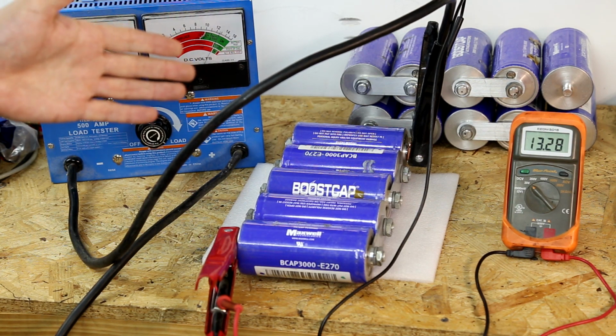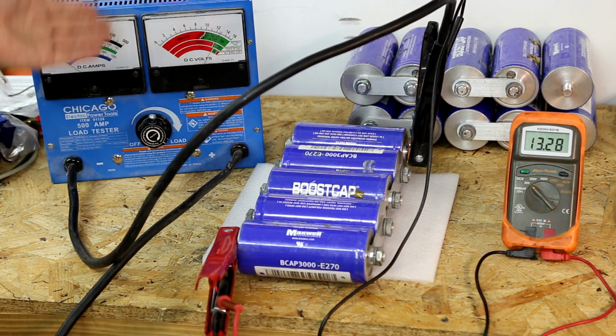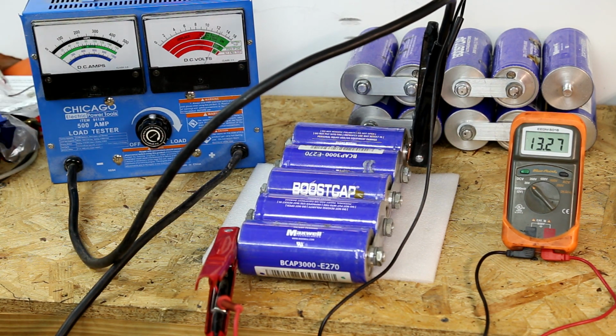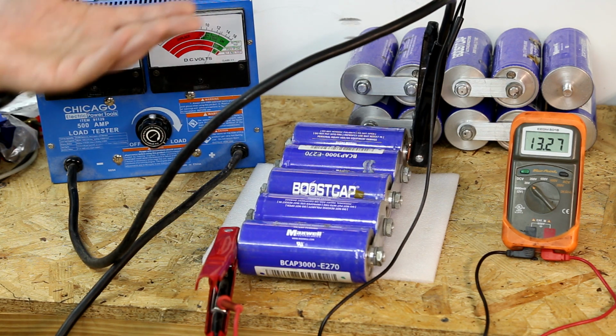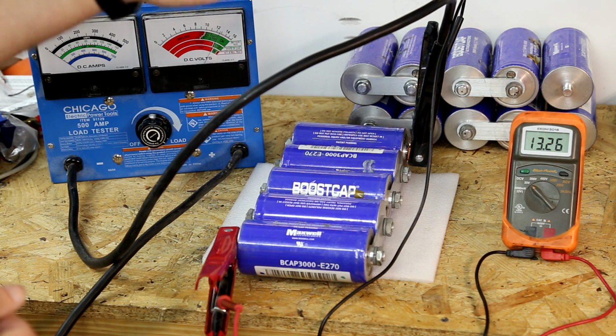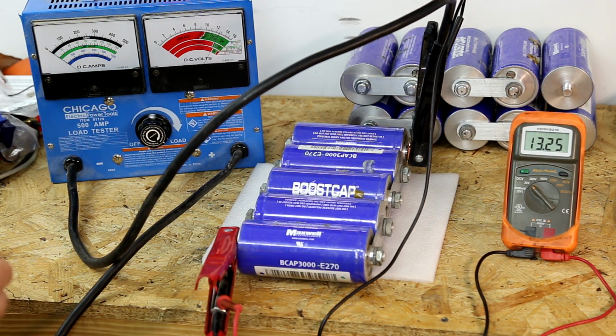You can do the same thing for a battery. You would take the amp hour rating of the battery, say it's 100 amp hours. You divide that by the current that you're putting on it, so you can select the current. Let's say you did 100 amps. You can do that 100 divided by 100, and that will give you the amount of time in hours that it should last. Being a 100 amp hour with 100 amps, it should last for 1 hour. It kind of explains itself with that example. But if you do the math for any amperage that you choose, you take the amp hour rating, you divide that by the number of amps, and that is the amount of time in hours, which you can figure out in minutes, seconds, otherwise, to see what a working scenario should be for that.